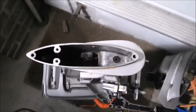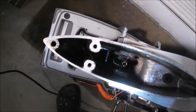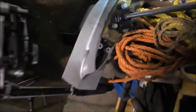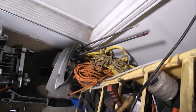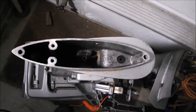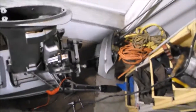With any luck, turning these upside down, they'll just slide right in. If you have trouble getting it to go in, you're probably going to have trouble getting the water pump tube into the water pump housing — watch for that. Once it's on, I'll put earmuffs on it and start it up. If it doesn't pump water pretty quickly I'll know to check that tube, in case it isn't inserted into the hole correctly.